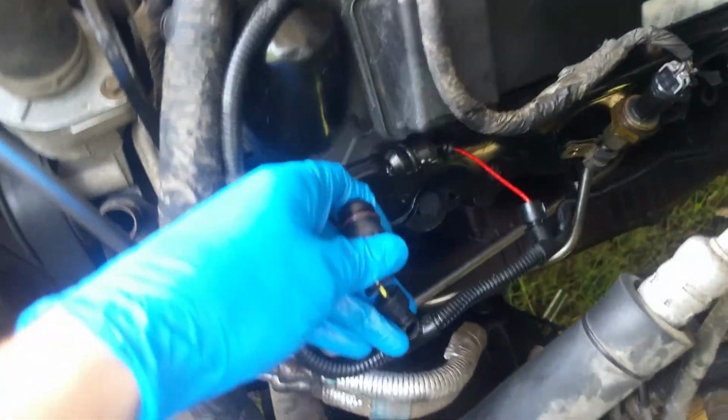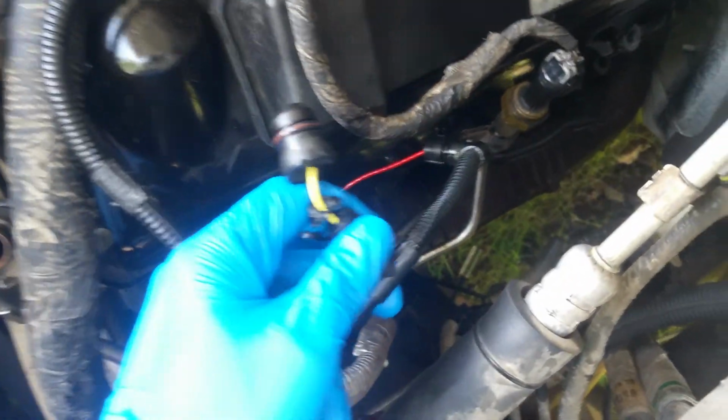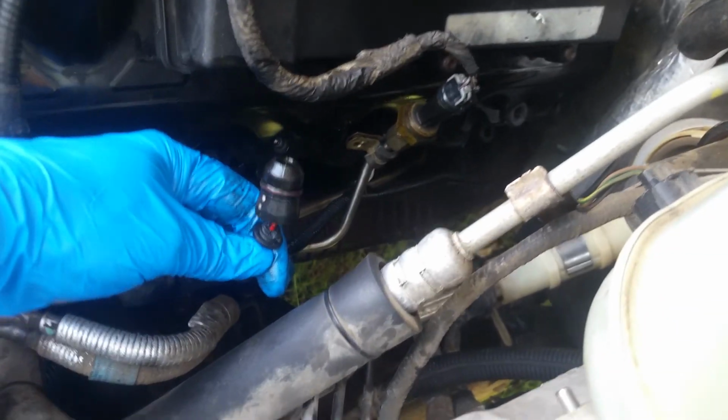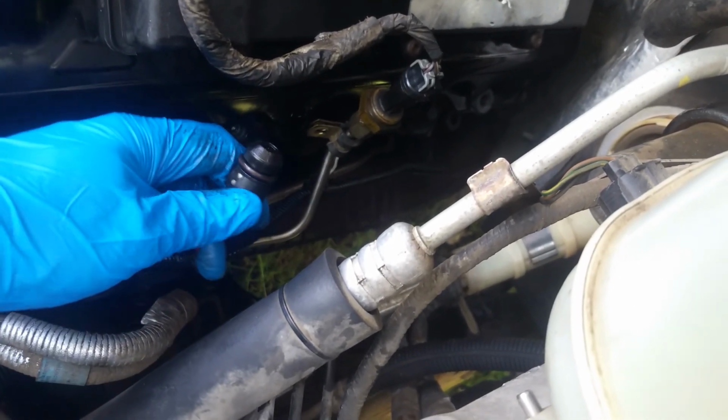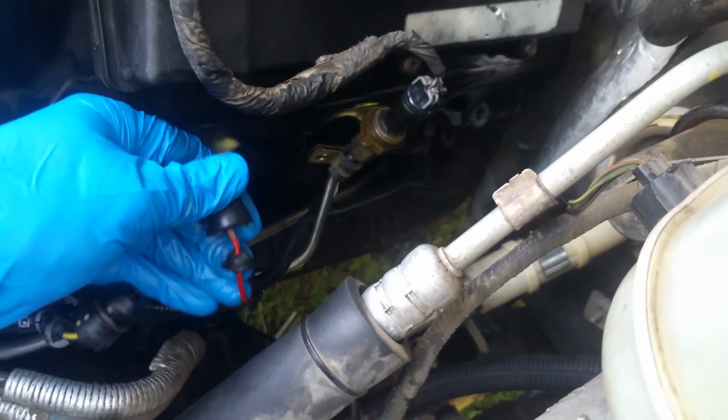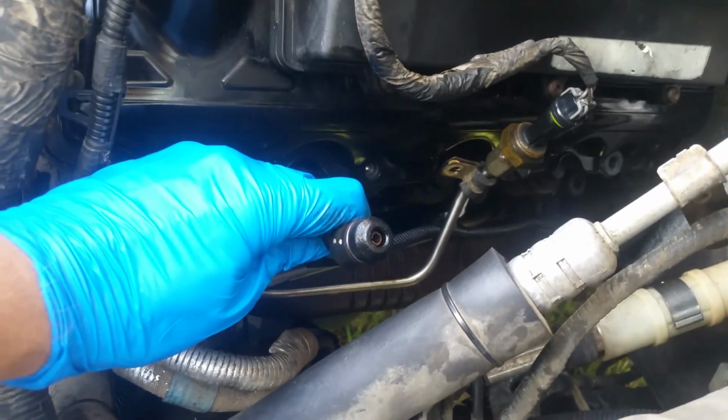Okay, I just wanted to tell you how I was removing these. I am just using a screwdriver and kind of tapping around this part, and then I've just wound up getting a screwdriver and just tugging on this right here. And like I said, they're going to be damaged regardless because they're just crumbling to pieces. I even tried the tool. It doesn't work on these. I mean, if they weren't so brittle, it would, but you can get a hold of it and yank on that wire or tap it around with a screwdriver and pull on this part here. I thought the wire was going to pull out, but it didn't, and with a little bit of tugging it came on out of there. So you really just got to get them out of there any way you can. You can get these replacements, and that's just what you're going to have to do. That's the reality of it. If you have to remove these glow plugs, you're just going to have to replace these harnesses here.